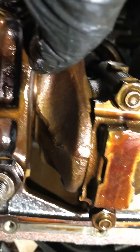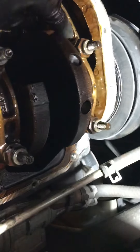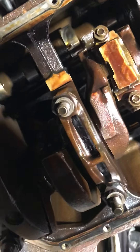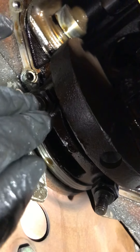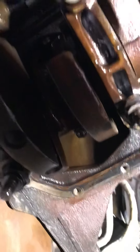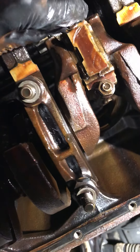You can kind of see right down in there. Let's see if there's any wear on that one, but nothing except for that darn thing. Would that noise sound all the way back here? It doesn't make any sense to me. I think I'm going to pull at least a couple of these connecting rod caps off, use the plastigage on them and see. I definitely have to pull the rear main cap anyway because I've got to change the rear main seal, so I can plastigage that as well and probably this one. But I have a feeling the plastigage is going to look okay, just because everything is so stinking tight. But I'm in here — might as well do it, right?